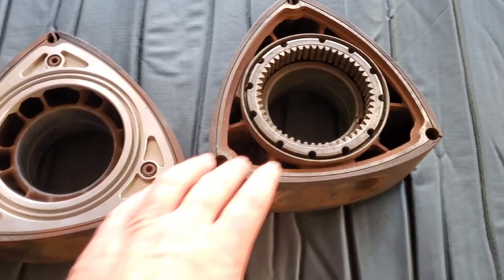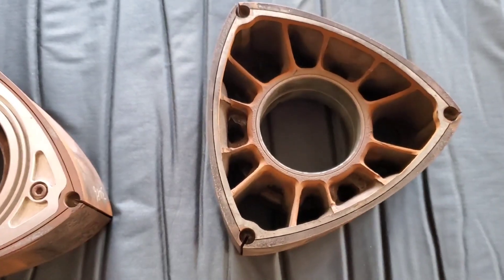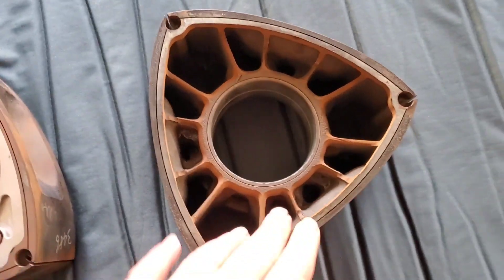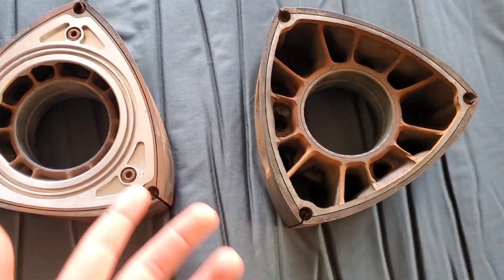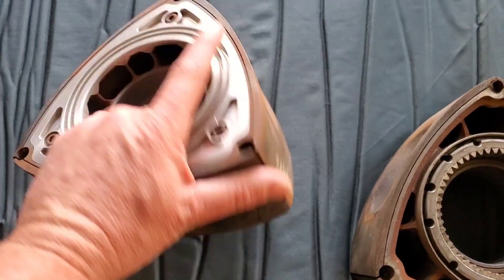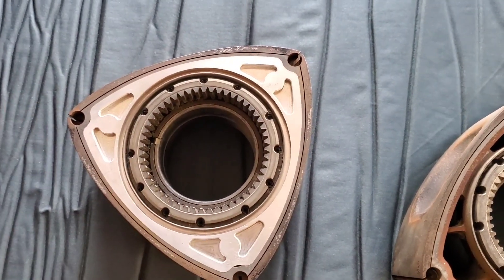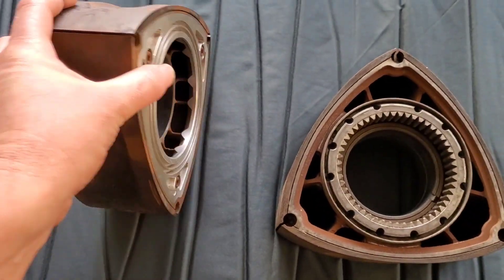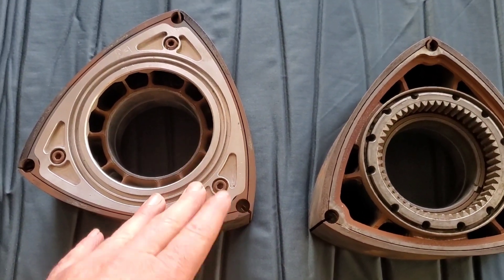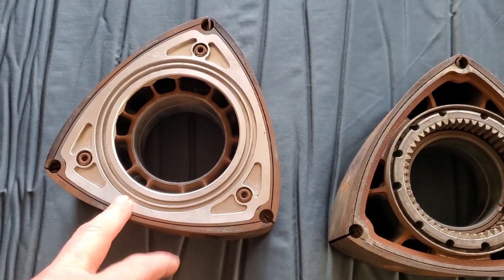As you can see, what was done is we took an OEM rotor — which other companies do lighten, and we even offer lightening at Mazda Trix, usually just pocket lightening. Racing Beat has done internal lightening, but nothing ever this aggressive. Our goal was to cut the entire face out of both sides and then lock the faces back in, so you could actually run aluminum face plates or some other type of metal that was a lot lighter than the cast material used by Mazda. Swapping that material to aluminum, creating a twin-metal rotor, allowed for significant weight reduction.